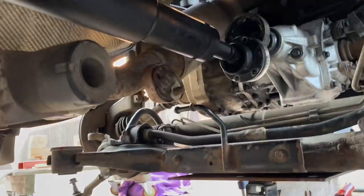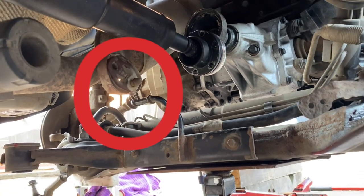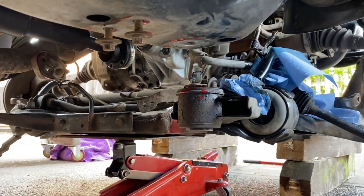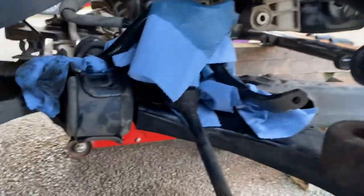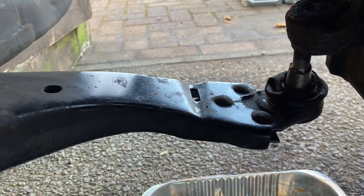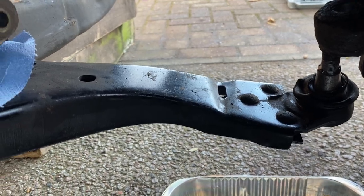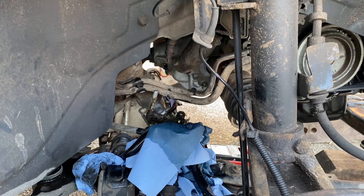There's a mounting for the exhaust - you need to drop this rubber bush to allow that to come away. I decided to do that before taking the drive shafts out, because trying to lever the wishbone arm down far enough to get the hubs out is a nightmare. I thought dropping the subframe would make life easier - I hope I won't regret that, we'll see.